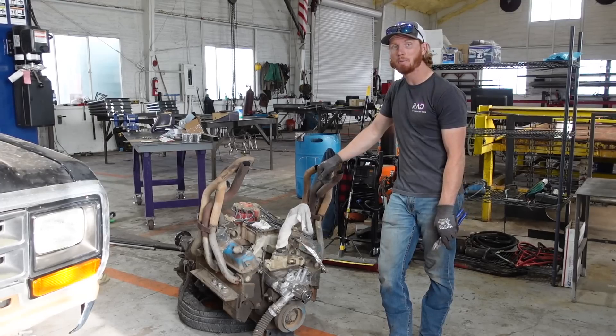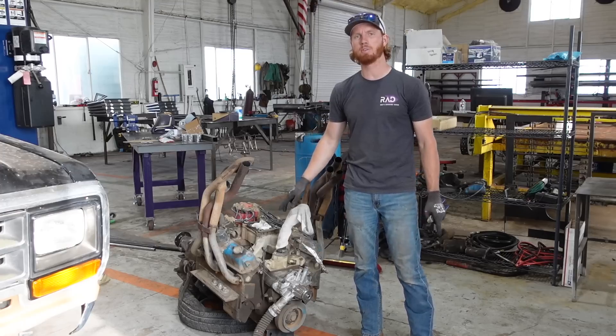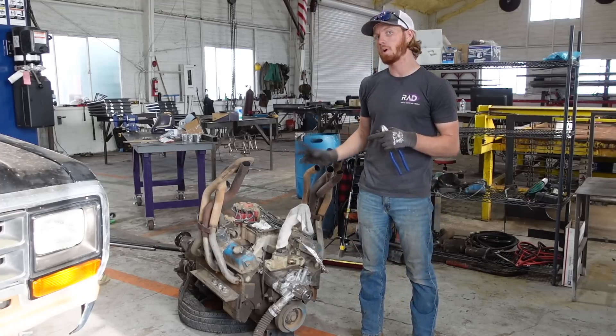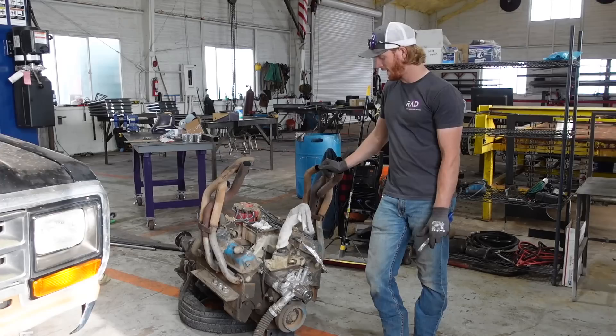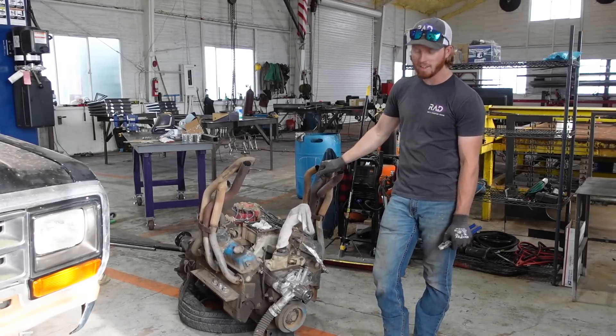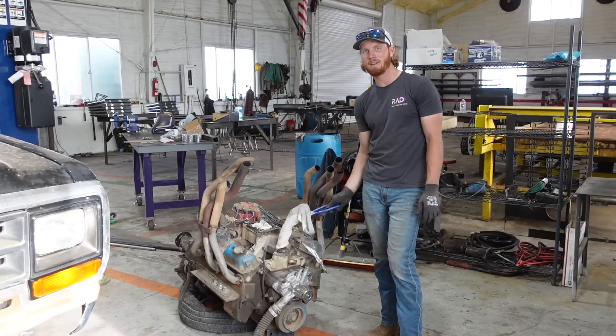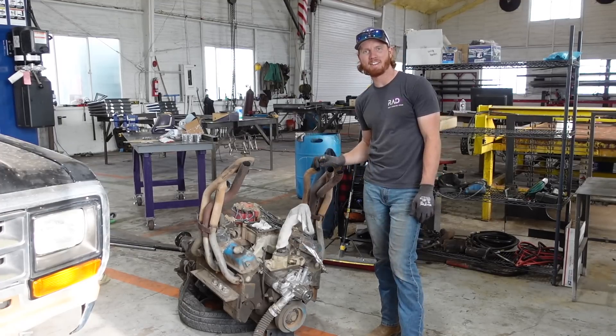It's time to tear into it. We're going for the intake manifold, we're going for the camshaft, we're going to pull the lifters for the cam as well. Other than that, everything else is kind of junk in it. There is a nut that fell down the intake when they were pulling it out of the derby car, so we'll keep an eye out for that.